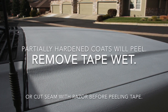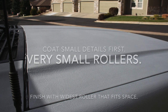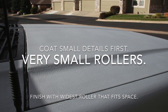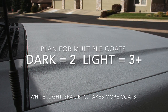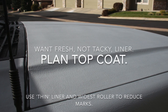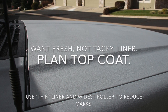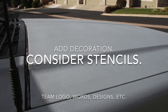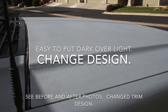The partially hardened coats are kind of flexible, so either remove the tape when it's wet before it starts to set up, or wait until it's good and hard and then use a razor to separate the tape from the coating. Use small rollers to get into tight spaces first, then finish with the biggest rollers that will fit. You're going to need multiple coats — the first one will go on thin because the old paint is slippery. For the last top coat, use really fresh thin liner; that will basically reduce the roller marks. You can add decoration when you're done — logos, words, designs, stencils will all work on this. It's going to look like a different vehicle anyway.